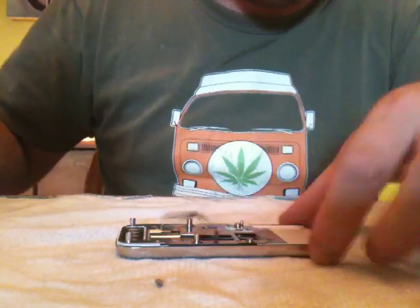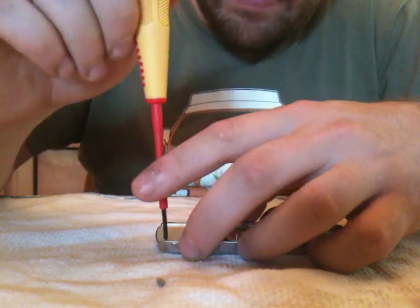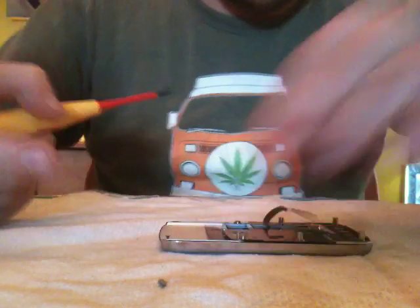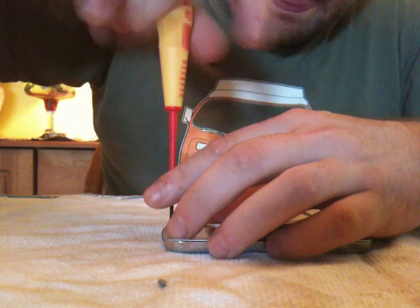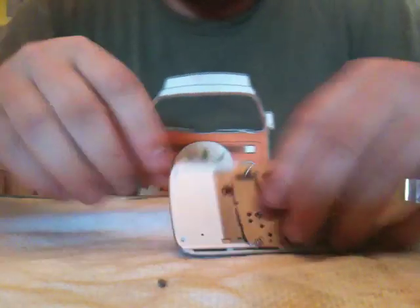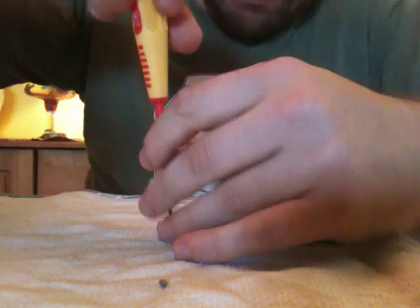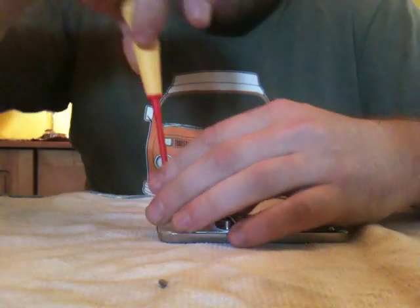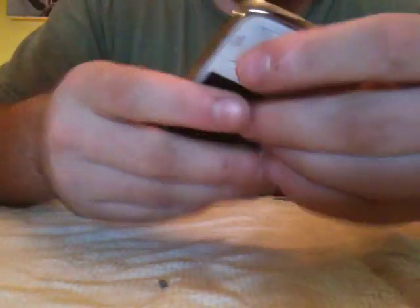This take apart is mostly for the actual screen and the bezel. So at this point, you take your Phillips that we had earlier, that I showed you, and you go about the 2 screws on the top, and there's also 2 screws on the other side. So take out the first 2 small screws. Now these 2 are gone. You slide it down, and there's 2 more right here. And there you go. So now basically all the screws that you need are taken off.